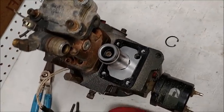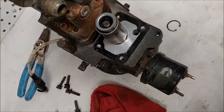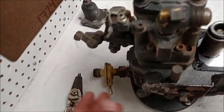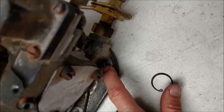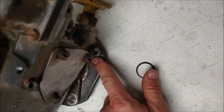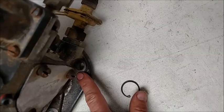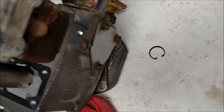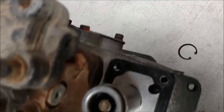Pretty easy, pretty straightforward. I would say do it off the truck — it doesn't take that long. The longest one took me about 20 minutes and that was one of the first times doing it. When this is in your truck it sits just like this. This back bolt right here is going to be a 12-point bolt — I believe a 7/16ths shorty wrench is what I used to break it free. When you get the wrench on there you're going to curse my name — there's less than an eighth of an inch to turn it. But it doesn't take much once it's broken free; one or two hits with the wrench and you can use your fingers to get it out.